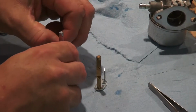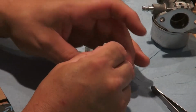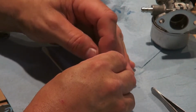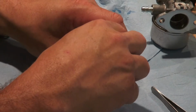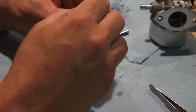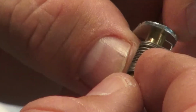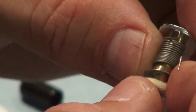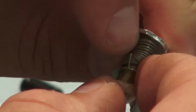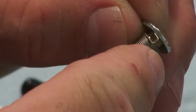Right here's the throttle linkage. I'll take the bushings and assembly and spring off, place it on the new one, on the replacement. Alright guys, you see the bent end of the spring there? It needs to lap over to put spring tension on the lever itself, on the plate, so I'm going to lap it on over. Well, where are we here? There we go.